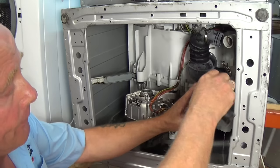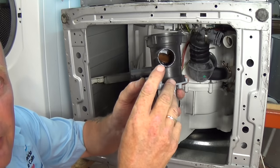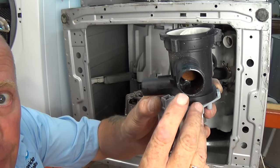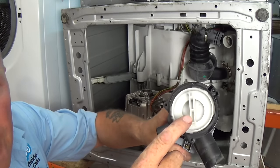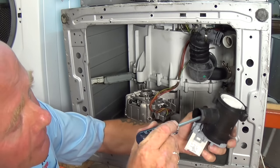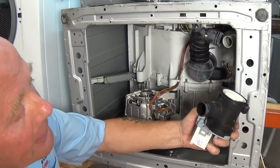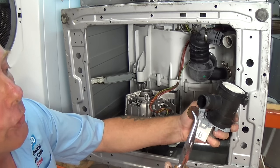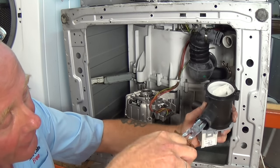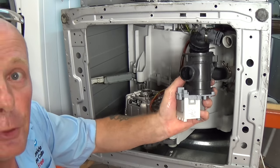As you can see it will not turn, but if you look closely at the side you can see a coin that has jammed itself against the filter. If you tried to force this, all you would do is break the filter. What I suggest is to use a screwdriver to remove the items — you may also need some needle-nose pliers. In this case there is a two pence piece and a screw.